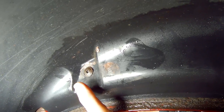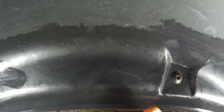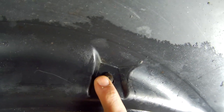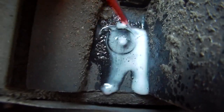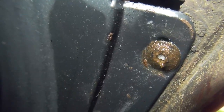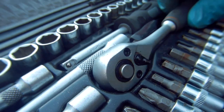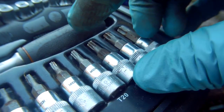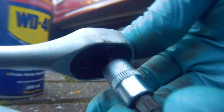And there are two more at the top of the wheel arch, which are out of sight here and face inwards towards the car. It's probably a good idea to spray the screws with penetrating fluid and then clean out the star recess with a sharp point of some kind. Then take out all the screws.